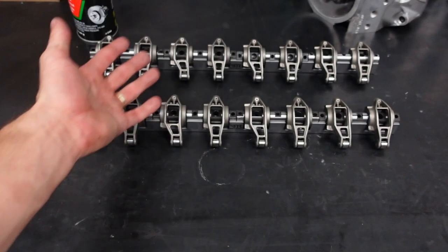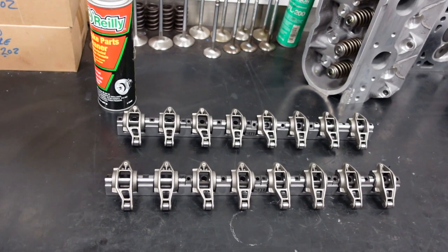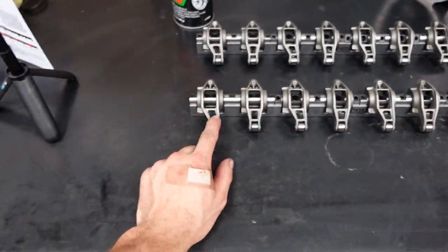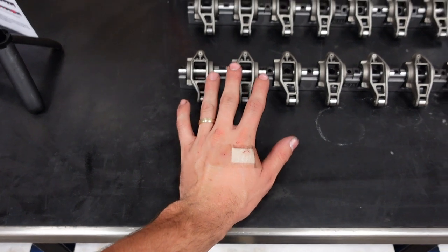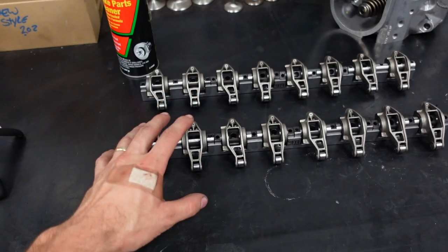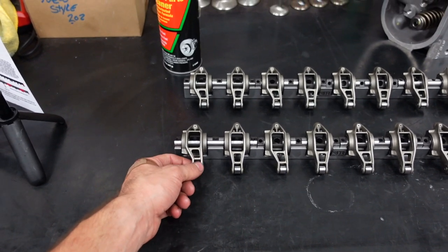So with the new combo, my goal and the number I'm going to reach is the big 200. And so that could be a 25 second pass. I don't really know, but I want everything in tip top shape so that when I throw it in fifth gear and start to lay on the RPM, I can have confidence in the motor that everything's gonna survive and handle it. Oh, I'm also running 680 thou intake lift and 663 exhaust lift. So I want everything as sturdy and rigid as possible while these guys are bouncing up and down at 7,500 RPM, just sitting there in fifth gear.